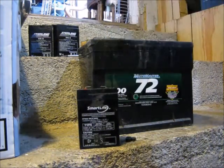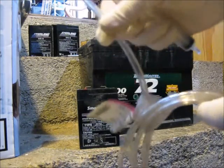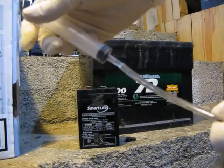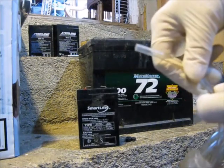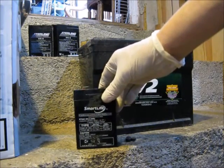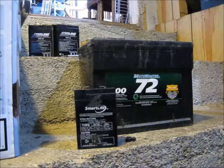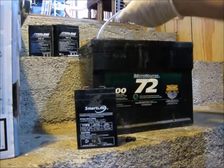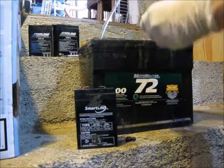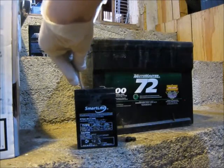We're going to use this syringe to transfer some acid from the big old battery into the little battery. If the syringe doesn't go in deep enough depending on the size of the opening, just get a little piece of tubing and add it on so it reaches all the way in to extract some fluid. You shouldn't need very much to top it up — if you find you're almost filling it, it's obviously kaput, but then you wouldn't have gotten any voltage when you checked it with your voltmeter. Just suck up some of the battery juice and introduce it into the new battery.